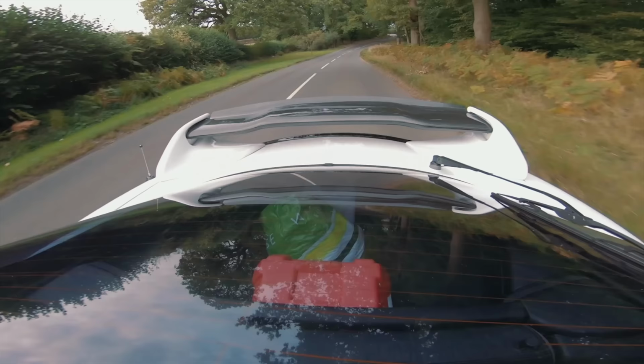Is it the suspension, do you think, or do you reckon it's just the character of this car? Because honestly, such small movements and the car is really hugging the road. Yeah, real small movements. I am quite impressed with them BC coilovers, they are good. Also, I think the arches are 25mm wider. I've spaced the wheels out, so I have got a wider track stance. And sticky tyres, so I think it's a combination. You don't have to turn the wheel at all.